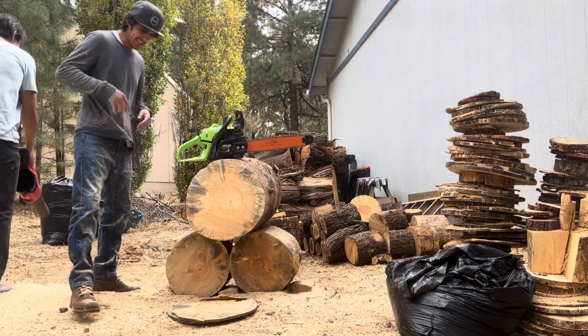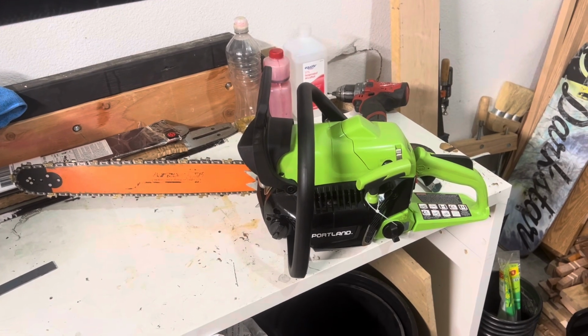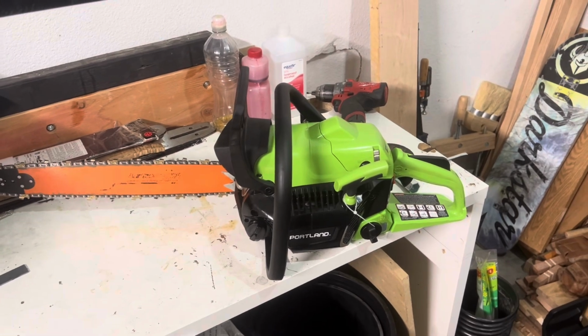Good, huh? Nice, it's a little soft. All we did was delete the base gasket, move up the exhaust a couple degrees, move the intake down a couple degrees, and put a lung in it.